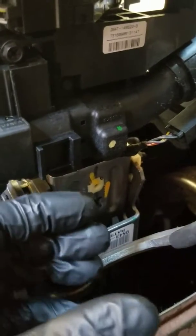The problem is the ignition switch is held in by a plastic tab on the bottom and one on the top, and the switch actually walks around in there a little cattywampus. What happens is this joint in here wears out and doesn't allow the starter signal to be completed on the ignition switch.